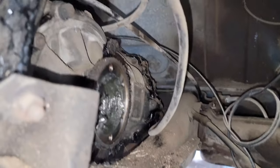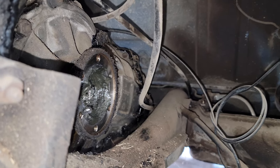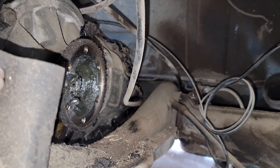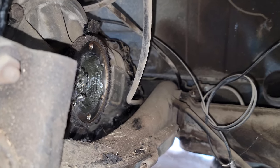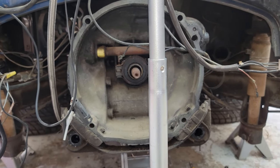Also, what you've got to worry about is attached to this harness right here — this cable — there are two electrical connectors at the front of the transmission that you will have to disconnect also. It's a little tight right now, so I'm going to get the transmission out a little bit and then I'll disconnect those. Next, I am just going to pull the transmission straight out the back.